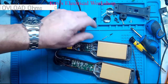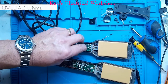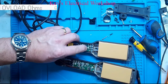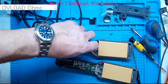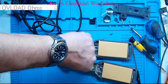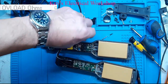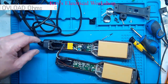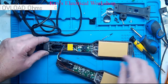I would normally take the switch apart, but this is very stiff. There are two types: one which has got two springs and one which has got a single spring — this is a single spring. The action is much harder to switch on. The problem is when you take it apart you cannot for love nor money put them back together — well, you can, but it'll probably take me 15 minutes. And the action doesn't actually go wrong as much as the other ones — there seems to be more tension. So I'm not going to worry too much about that.